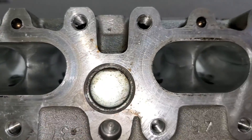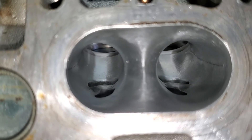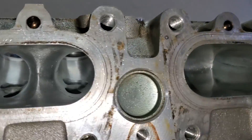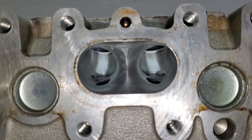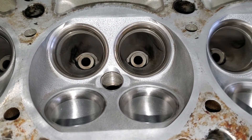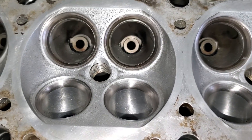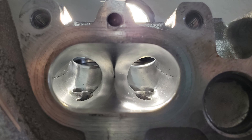And there you have it — here's the final product. It really turned out really nice. However, there's a couple of spots where I dug just a tiny bit too deep with the multi-purpose cutting tool, but it really shouldn't be a problem — just a couple of tiny little nicks on the center divider in the exhaust. But this all turned out really good, and this is definitely going to flow exhaust way better than stock, and it's going to spool the turbo faster too. Along with reflecting heat out of the ports and keeping it in the exhaust, which helps increase exhaust pressure and in turn exhaust velocity — a whole bunch of stuff that adds a tiny bit of efficiency here and there. At the end you have a much more efficient engine, and that's the hope with everything I'm doing with this build. If you guys are getting value out of this, leave me a like, leave a comment if you wanted to see something different or have a question, and subscribe if you haven't yet. See you next time.